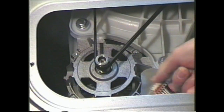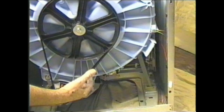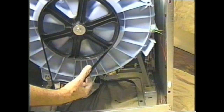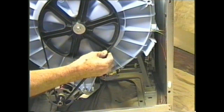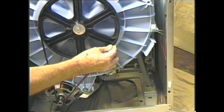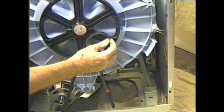Look at the motor plug — it can be refitted wrongly because there is a vacant section in the socket that would allow you to fit the plug in the wrong position. If you ease the belt towards yourself while turning the pulley anti-clockwise the belt will come off easily, but be careful you don't catch your fingers between it and either of the pulleys.